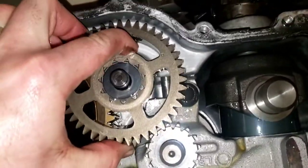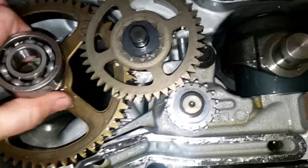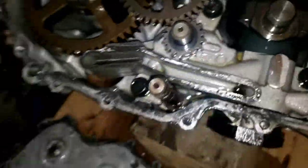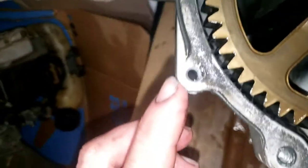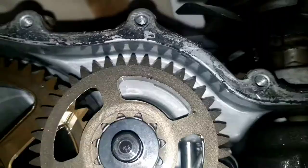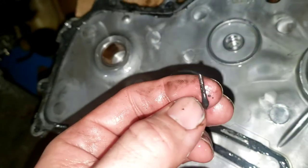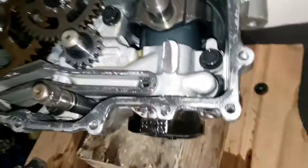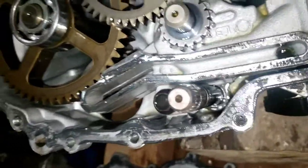So all these gears are gonna have to come off — and as you can see, they look pretty easy — but all this has to be pulled, which means all these seals are probably gonna need to be done. I'm gonna have to get some RTV — I'll look it up though. It doesn't look like a gasket — see how it's not out here on some, but on others it is — so to me that says RTV sealant. It's loopy and thicker where it's breaking off. Using RTV is actually good for me because it means I don't have to buy an $800 gasket.